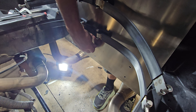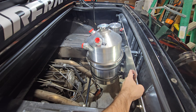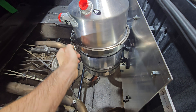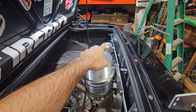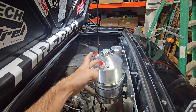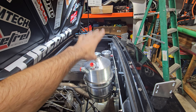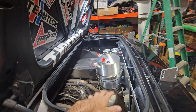It's basically done and in there. It's at the point now where it's super solid, very strong. This wobbles a little bit right now just because the top mount is loose, but it's not going anywhere. I did not mount the breather tank because I didn't know if that had a specific height or placement it needed to be. I saw a lot of people move them all over the place. All I know now is I need to vent that out of the car so it's not in this compartment.